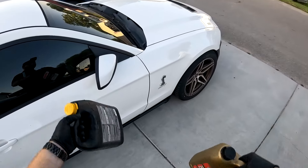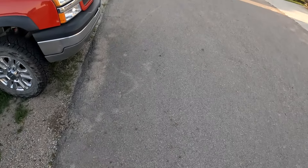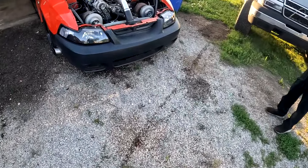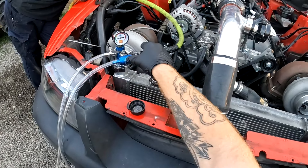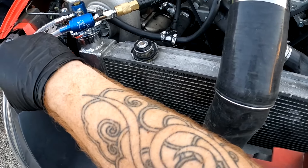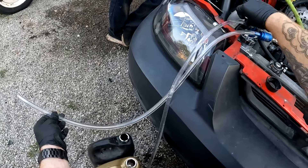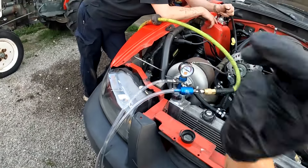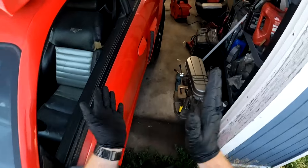All I got to do is tighten up the intake hose, plug in my IAT, do a vacuum fill, then top it off with coolant and go drive it. I'm going to have to use water instead for testing. Let's vacuum fill it and put the water in. Sitting here at 25 - here we go, boom. I would use coolant but this is for testing purposes only. Coolant system topped off - now we just got to start it and make sure we're not going to overheat.